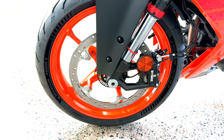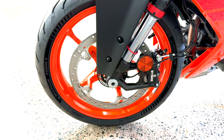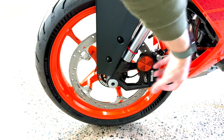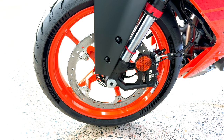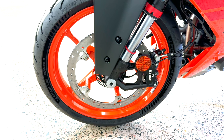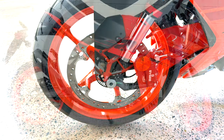Flipping around to the other side, you can see the brake disc here. It's mounted to the wheel — likely a lightweight and style choice, which is what KTM does. You've got the ABS ring in there. It's not just ABS — it's now cornering ABS, which has been updated along the way. You also have a radial-mount caliper; Bybre brakes are basically a Brembo sub-brand as I understand it. Quality braking here — this bike forgoes extra power and instead focuses on handling, teaching you to be quick and consistent through turns and braking.